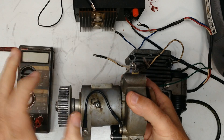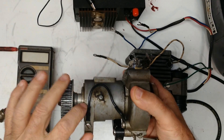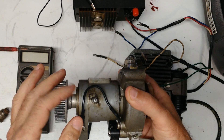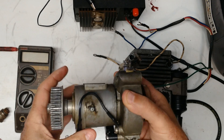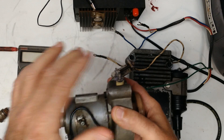So if you have any kind of weirdness at all with the ignition, that's one thing to check. In fact, when I take my hood off I sometimes will wiggle this. If you have to replace it, you need to find some fine-stranded, maybe silicone-insulated wire. It doesn't have to be super big — 18 to 16 gauge will work fine because even if it's points, it's only carrying 3 or 4 amps. And in this case, it's only a few milliamps.